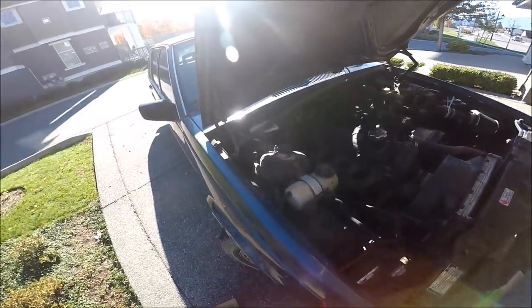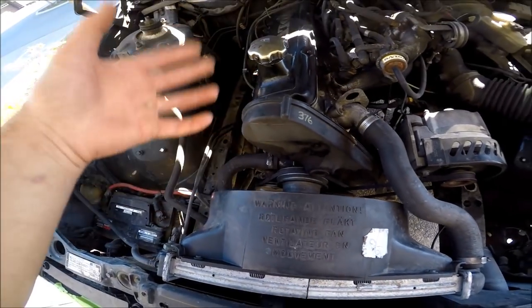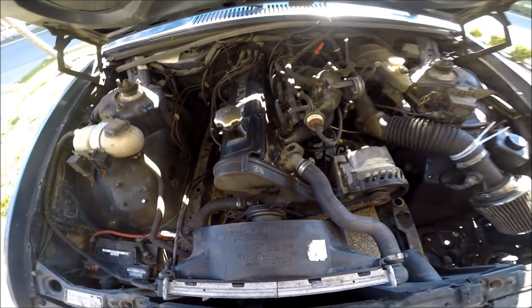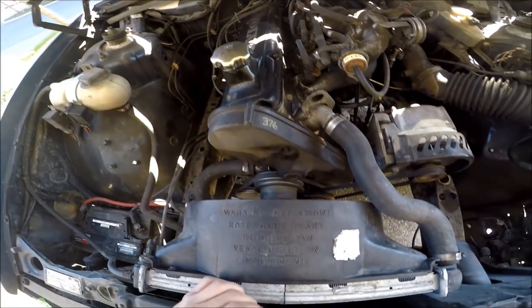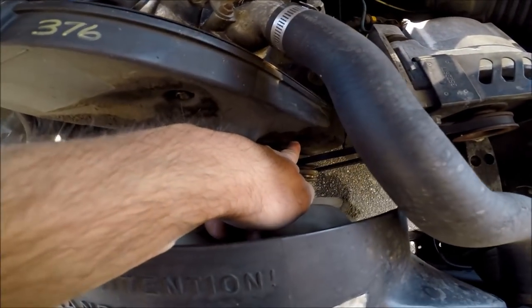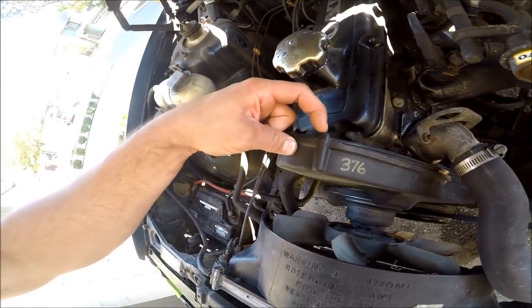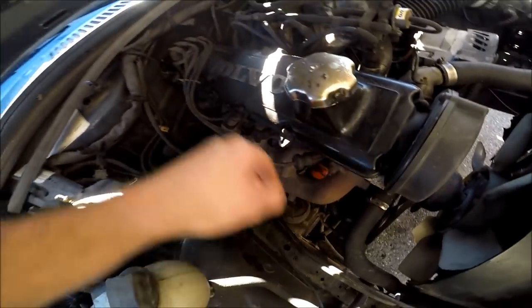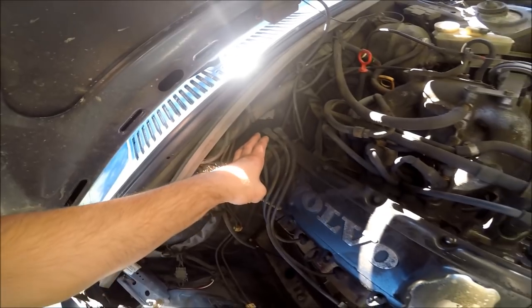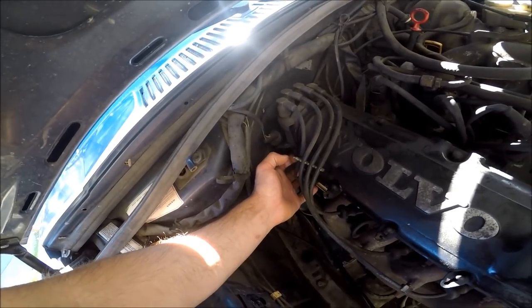Since the car has been so good to me and keeps running, I'm going to do a bit of work to it. Pretty straightforward — first we're going to take off this timing belt cover, remove the timing belt off the top pulley so we can mess with the cam. There's a 12mm bolt down there, a 10mm right there, another 10mm there, and a Phillips screwdriver head. After that I'm going to disconnect my spark plug wires from the distributor.